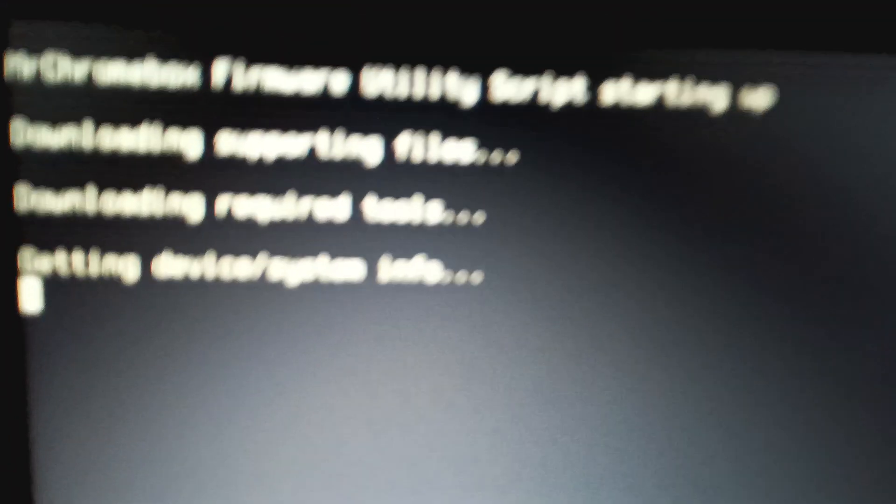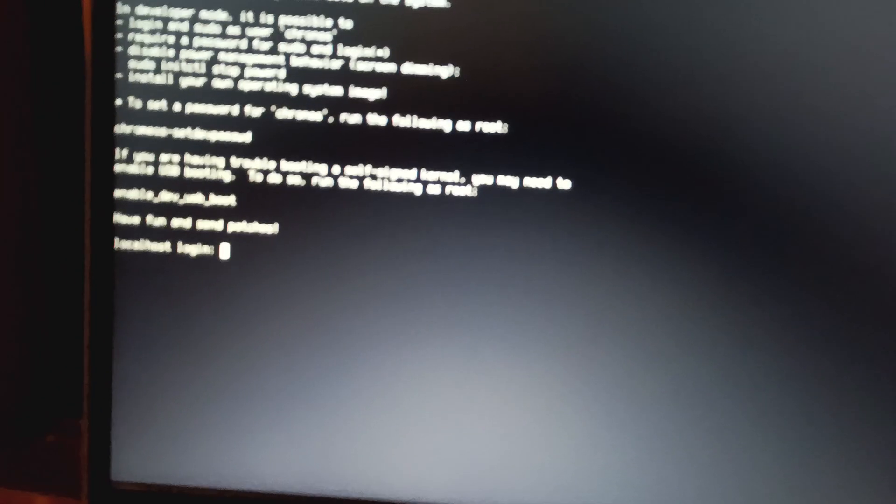It's working. You can see it now shows files needed. The directory has software write protection enabled. If you plan to flash UEFI firmware, you must disable it for flashing. Then type Y of course, and it will reboot.